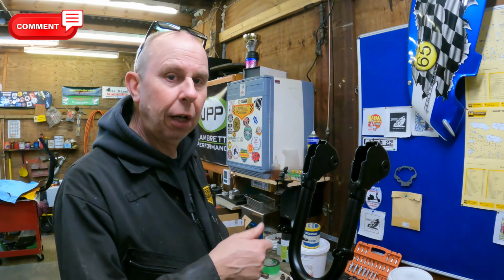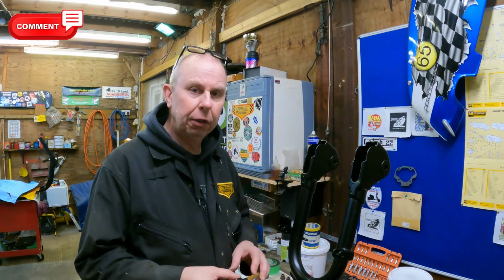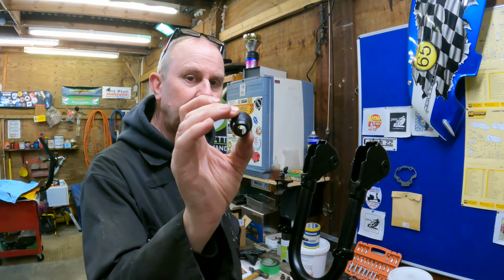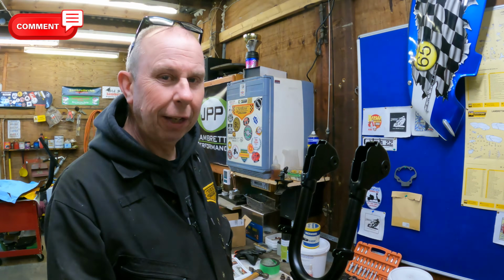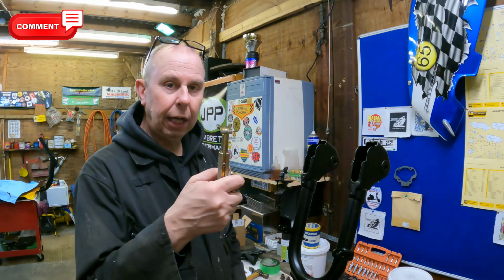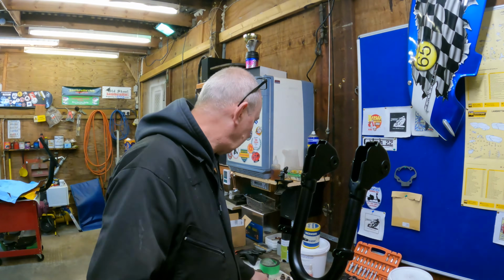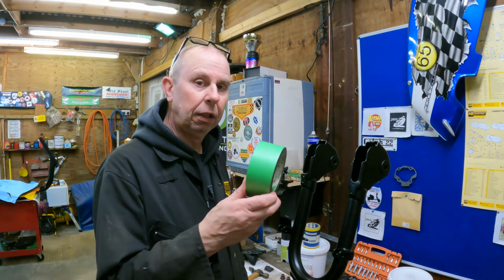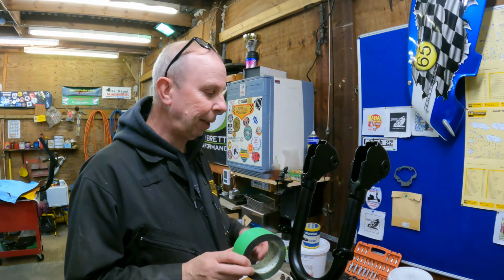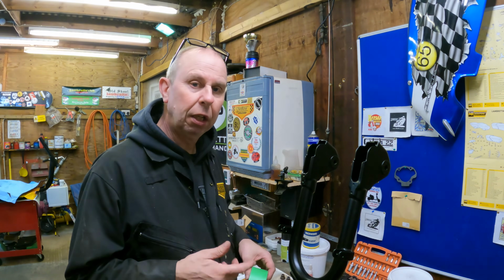We've done a bit of a dry build and everything seems okay, so I'm going to start reassembling the forks. I'm going to put some new cups or fork stops in. They're only cheap, you can get them from anywhere. Grease everything up, and then use my handy compressor tool to pull the spring down so I can get the links in. But first, I'm going to wrap some tape around the forks to stop damaging them when we bolt the tool on.